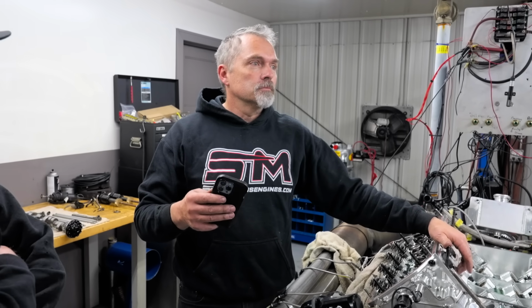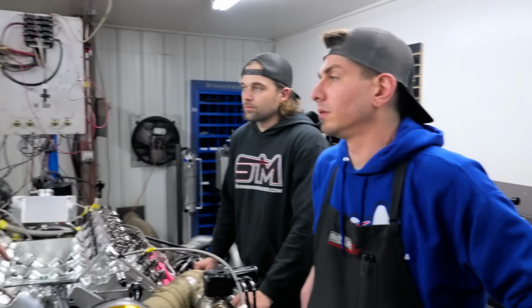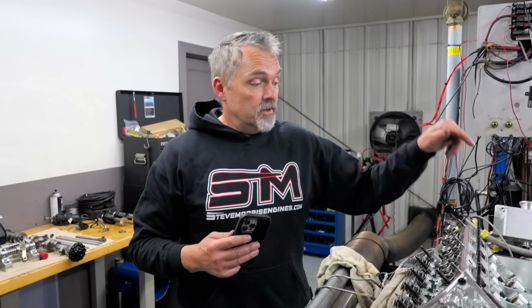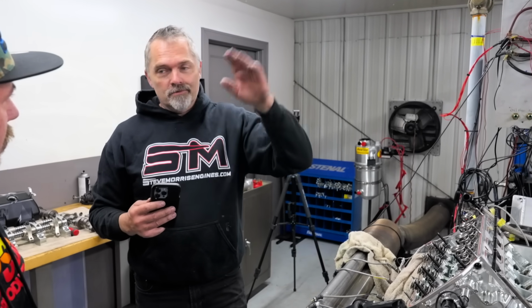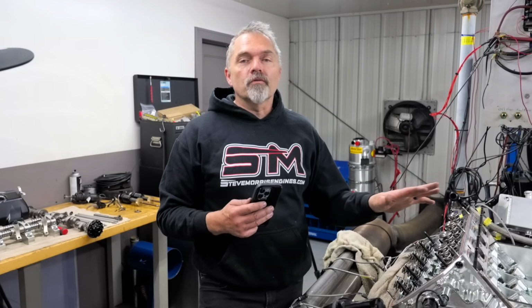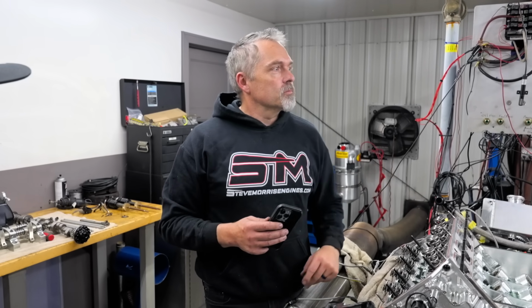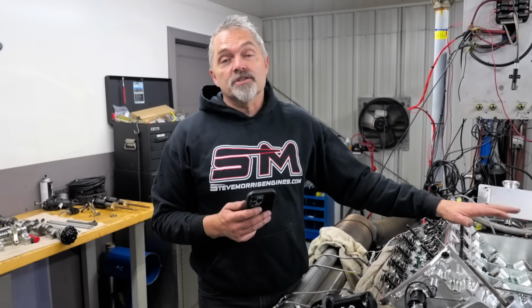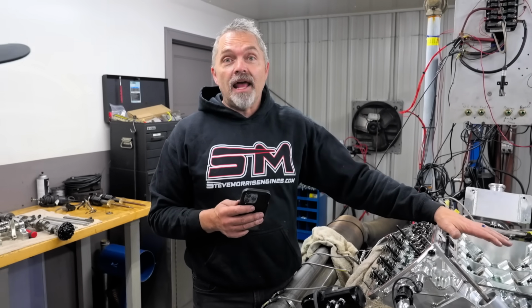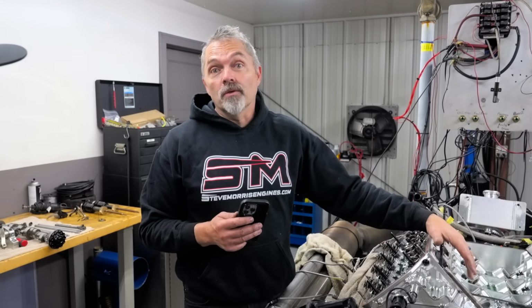So it quite literally would run out of oil going down track if it doesn't have enough oil in the pan. And they'll overfill the snot out of these things, with the crankshaft riding through oil. I don't know if Proline is doing that, so don't send me hate mail if they don't. But that's just a general statement. They actually have to add oil to these things in order to get them to run the quarter mile without sucking the oil pan dry.